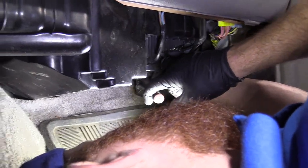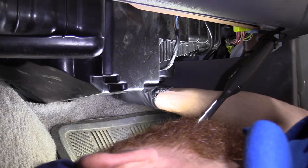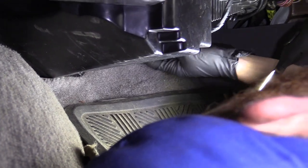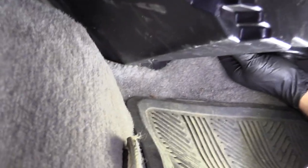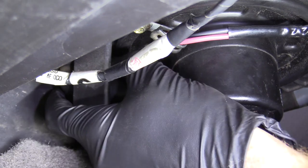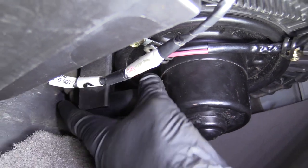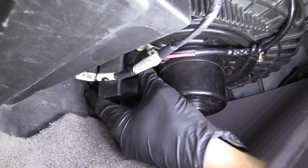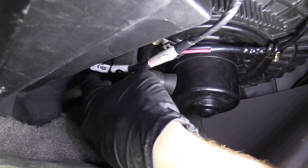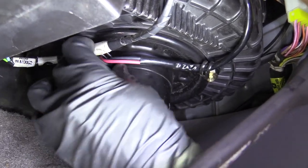That's pretty much bottomed out — just give it a teeny bit more. Now we've just got our little rubber hose here. You just need to make sure it's still in the blower motor, which this is, and then press it up into the box right under there. You can tell where it needs to go just because it's got this plastic area — it goes in between there and then straight up, and it's going to line right up with the hole right there. Put that there, put this back inside the blower motor. Get that up on there. Get our wiring all bundled up — looks great.